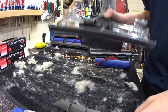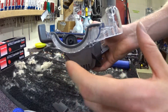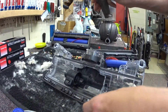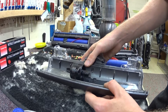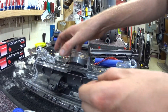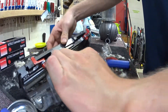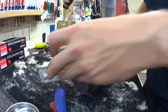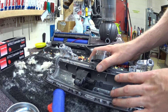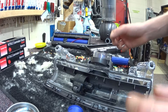One of those slight modifications is the cleaner head. Dyson at some point decided to elongate the cleaner head and put in a separate scoop here. What this scoop is supposed to do is encase the brush roller for more efficient air flow and then suck off the top. There's only about so much gap it can suck through, so it ends up really just restricting air flow in this variant. The original variant, which also had an extra brush strip, didn't restrict air flow as much.